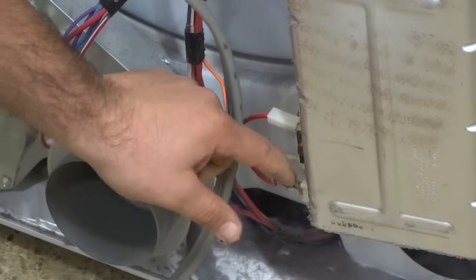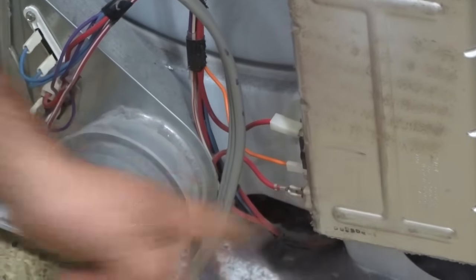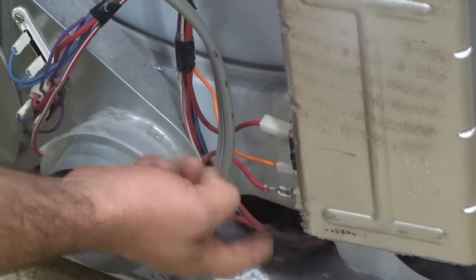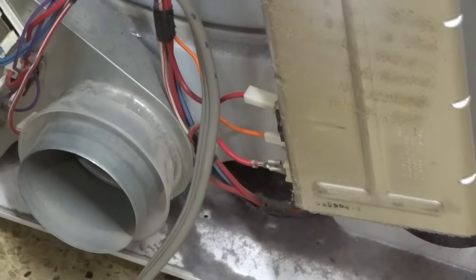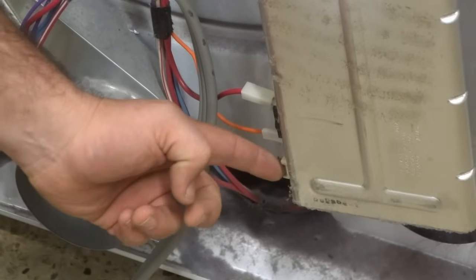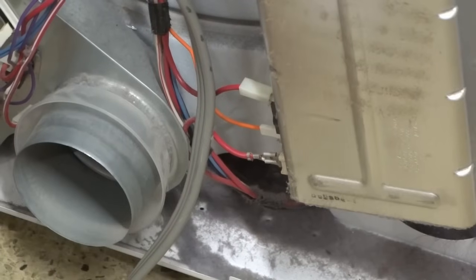with the heating element. Rather than pull too hard on this one that's kind of stuck, we're going to show you real quick how to pry this off the easiest way so you don't damage the terminal ending and you don't damage the wiring. On some of these, the heat here makes these terminal endings stick pretty well. You don't want to be yanking at the wire. You want to make sure you put some pressure here to prevent the thing from cracking or breaking.